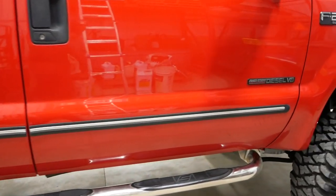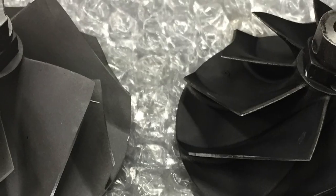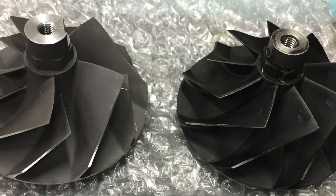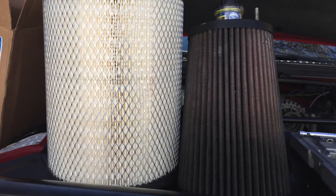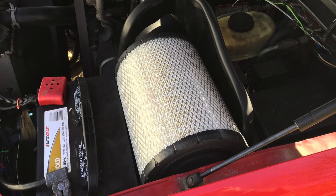Almost everything underneath is really clean as well. This truck has the standard TS6 position chip that goes up to 140 horsepower. When I got this truck, it was getting the common turbo flutter at higher boost levels, and I remedied that by swapping out the stock turbo wheel with the wicked wheel. While I was working on the turbo, I noticed that the air filter looked like it had never been changed, so I replaced it with the tried and true 6637 Napa filter.